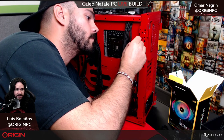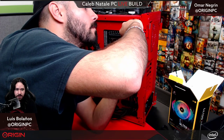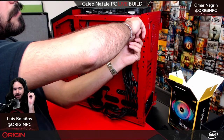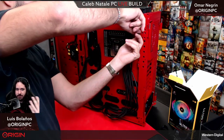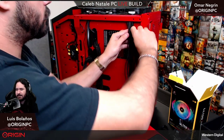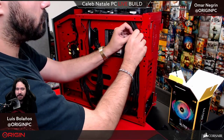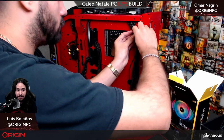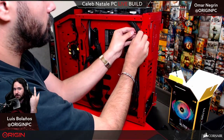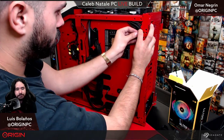I see there's a 2080 Super on the site, but as a blower fan, what's the advantage or disadvantage of that? So blowers are typically better for smaller cases where there's not too much air inside, because it blows the air out. However, the open air ones are better for larger cases. That's why we offer the blowers on the Neuron and the Kronos. Do we offer it in the Millennium? I personally don't recommend it for the Millennium. Yeah, I think we do. I would personally recommend the open air ones because I think they're better, especially depending on the case size. Blower is better for smaller. So, for example, if you went with two blower cards on a Neuron, that makes more sense because there's not too much airflow there, so the blower can just blow the air out.